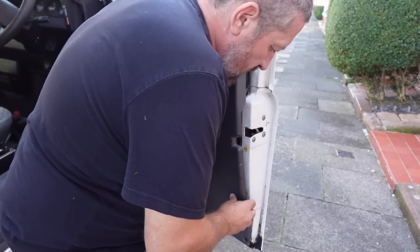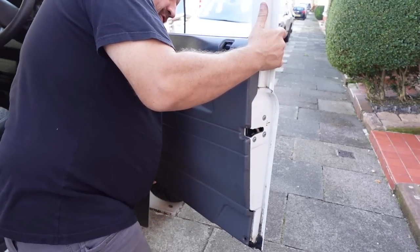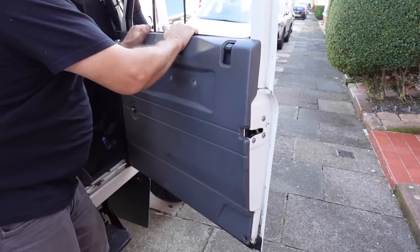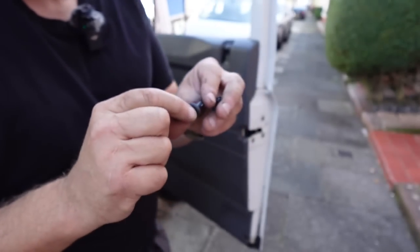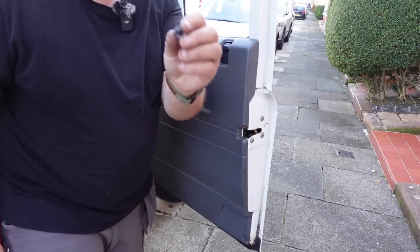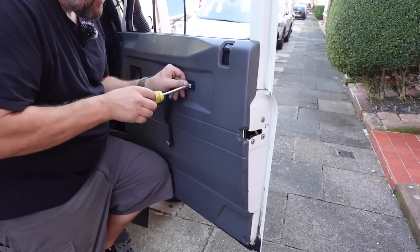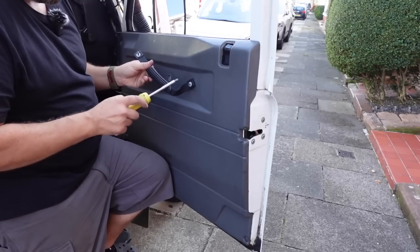The guide sits on there, this will drop inside, and then we find our bar which did fall down — it goes in from the back forwards. All of these yellow points need a fixing. There's one that survived removal, one that broke, so we need to remove the broken bits. Unfortunately one is actually broken off — we've got a repair kit for those but I haven't got it with me today, so we'll fit it now and come back in a future episode to show how the repair kit works. Get your bottom clips in place, then push the bottom ones in a little bit, line the top ones up, and firmly squeeze — and we're in.